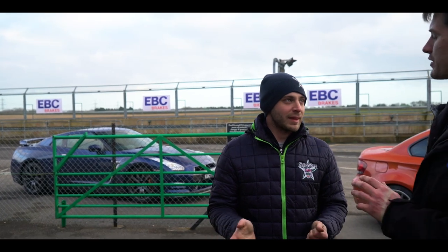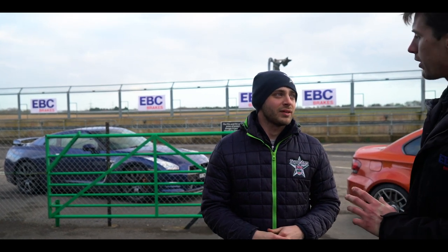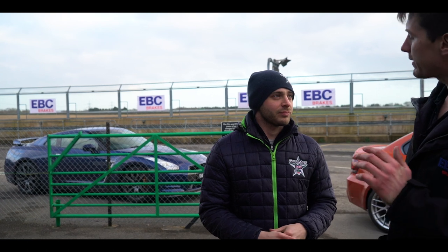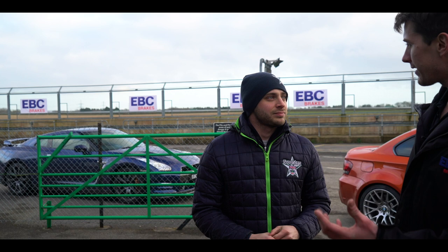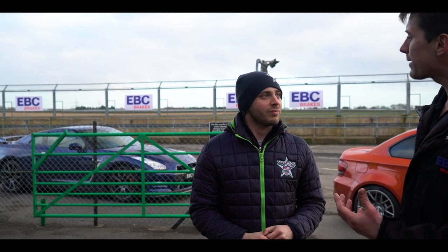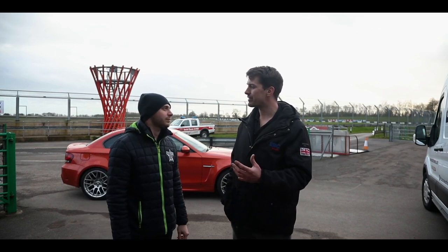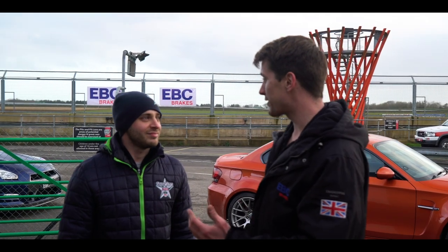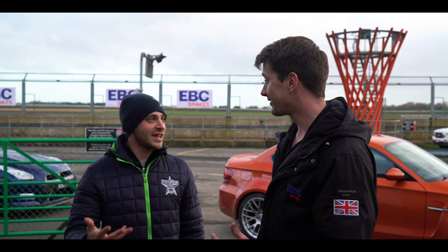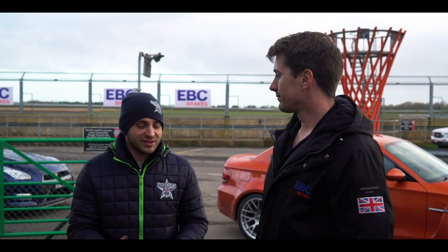So how many laps did you do in the Fiesta? 10 laps. And it was dry with the OE too, so you got comparable conditions. You said earlier that the pads faded after about 3 laps, which is what you'd expect because it's not really designed for the track, it's more of a fast road car. And on the EBC, what lap did you get to before you experienced fade? Didn't have any. In 10 laps of driving, we didn't have a single drop of fade.